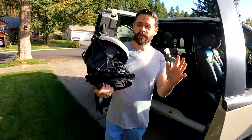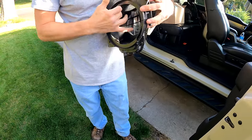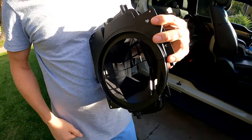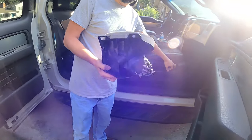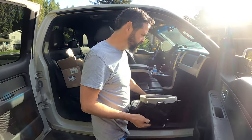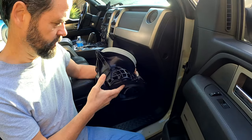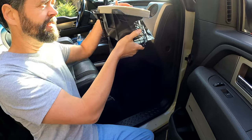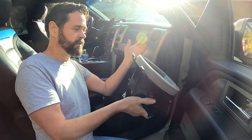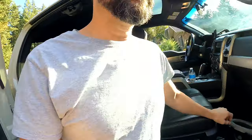This is the part where it's not clickbait because you see this screen right here. This is actually a new piece we took a part out of, because this is also where your fresh air and recycled air comes into play right here, and this breaks. So if you're ever having a problem in your truck with the fan being extraordinarily loud, we've got a video link on how to fix this without taking the entire dash out and console and steering column and venting the AC and all kind of crap. But this piece right here — the motor is here, so this goes at an angle and it sits up here as far in and as far up as Ford could possibly get it.